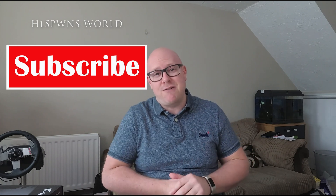If you've followed my channel — and probably not, because my analytics say that most of you are unsubscribed, so please subscribe. I've had boot issues and I've often likened my computer to a troublesome old car. Once it's booted and up and running, the machine and overclock are absolutely stable — it'll run for days. But sometimes, especially when it's cold, it has a little wobble. This was not just for me but for other people with first-gen Ryzen. Turning the socket off at the wall or cutting power on the PSU would resolve the issues, and the machine would boot normally, or you'd drop back into the BIOS with an F1 and an incomplete boot. You'd save changes — with no change made — and the machine would boot normally.